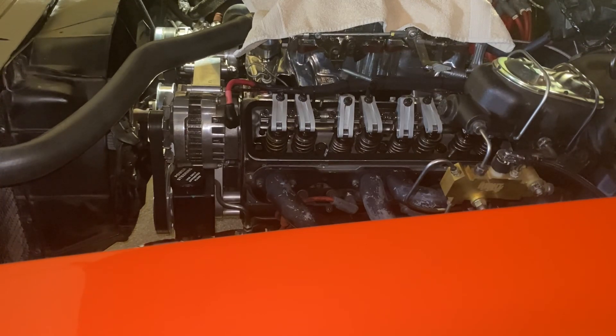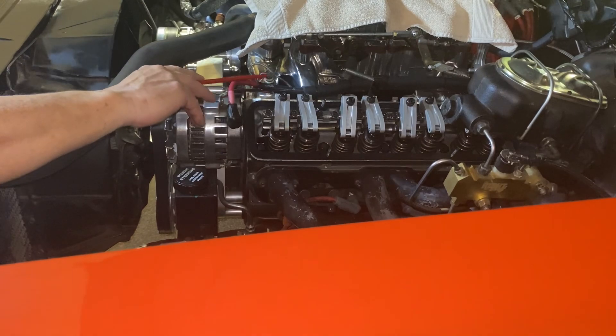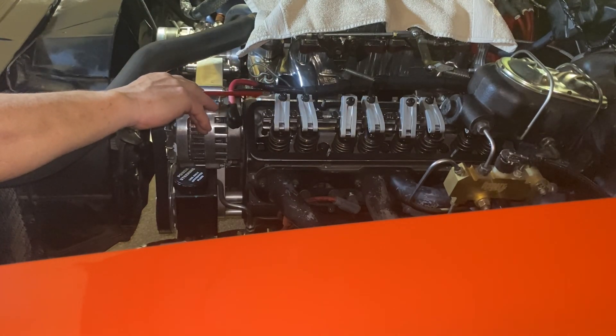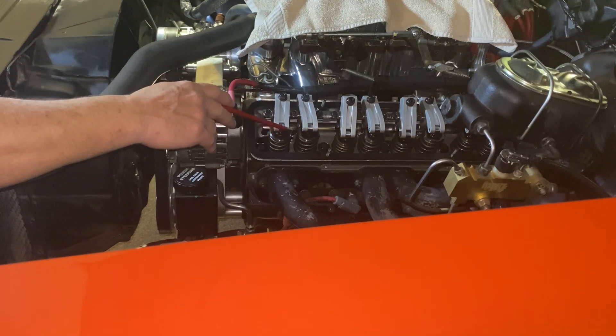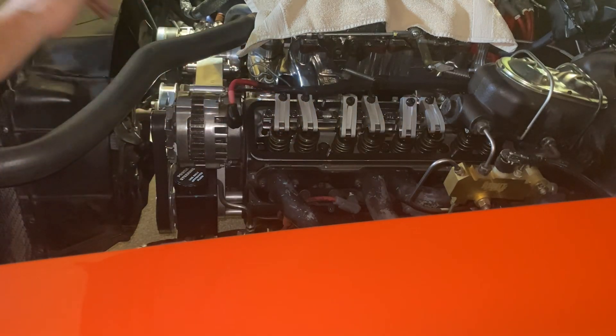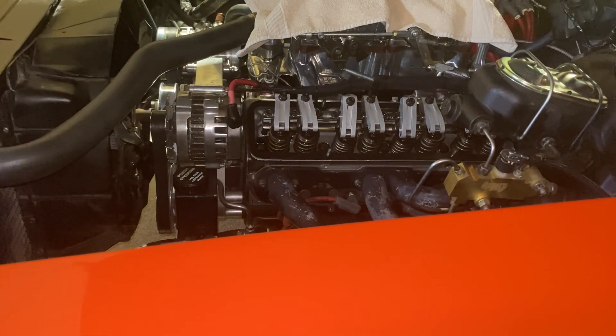So I took the rockers back off, tightened the stand down to 60 pounds, put the rockers back on one at a time, and tightened them down to 25 pounds. Spun the engine over with a primer tool down my distributor — I took it out and got a good flow of oil from the pushrod down to the trunnion, out to the tip, onto the top of the spring on the retainer. I think it's going to work out pretty good — I'll let y'all know in about six months. Pretty easy, straightforward installation, so we'll see how it goes.